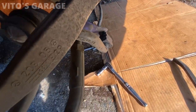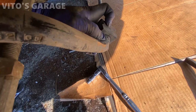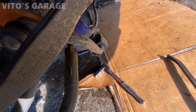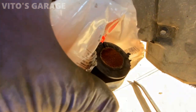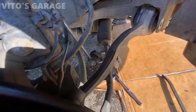Here's the progress on the sway bar. I'm going to be changing these bushings. It seems like these factory bushings don't have a cut in them, so I'm going to have to cut them because the new ones come with that - they have a cut in them for easy installation. And I'm ready to take all these control arms out now.